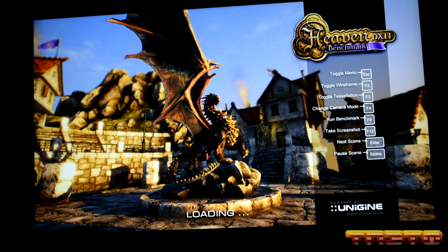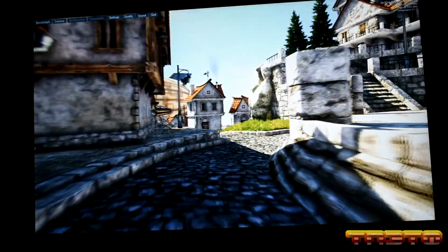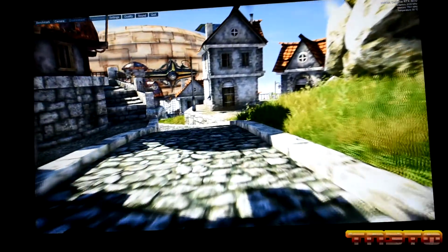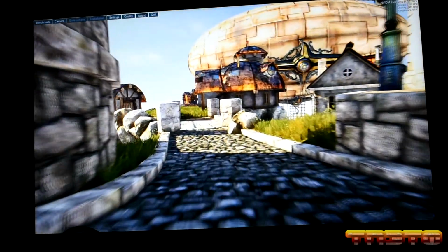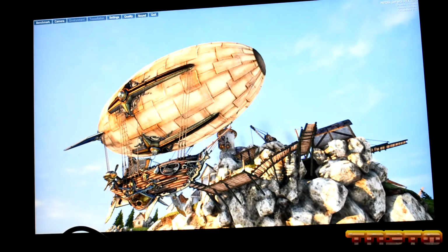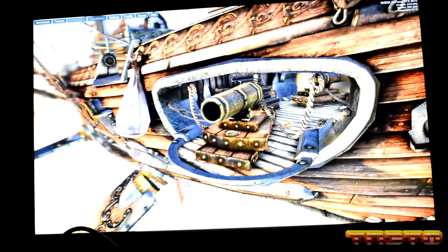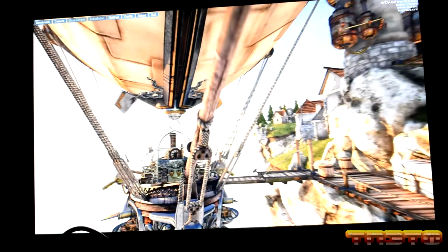And I am going to keep an eye on the GPU. Since we have something putting a load on it, it should do something. Now I'll start the benchmark. You have to click to start the benchmark. So I'm looking up in the right hand corner, which you're not going to see very well. I'll have to zoom in. The FPS is around 290 to 300 something. Yeah, like 350. Temperature of the GPU went up to about 57, 58. Temperature is up to 62 degrees. I believe that's the temperature of the GPU it's reporting, not the CPU.